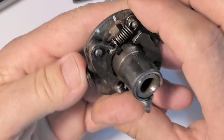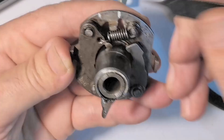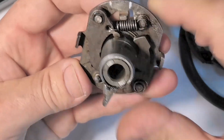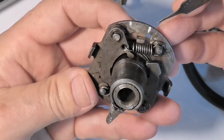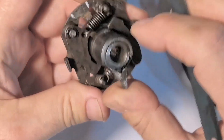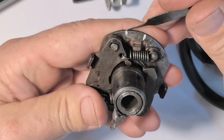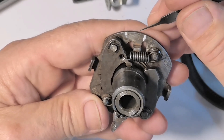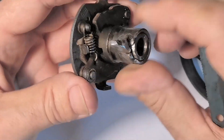Now we move to the advance mechanism — this is very, very, very important. Here I highlighted with white two fundamental points. First we have the 'T' — top dead center. Then this 'F' with the white line beside it is the idle mark, and then we have another mark which is maximum advance. That is the operating range of the engine — from one end of that white bar to the other is the calculated maximum advance for the engine. When accelerating and RPM increase, this piece, by centrifugal effect, moves, and that produces the shift in the spark. In short, it arrives earlier to the pulsor coil and the ignition point advances relative to the crankshaft position — producing an advance in degrees of the spark.